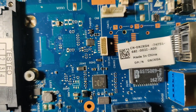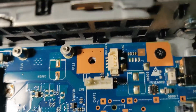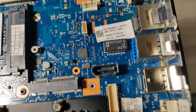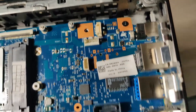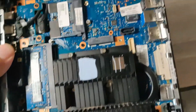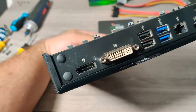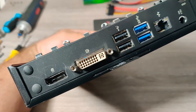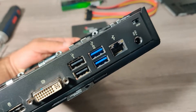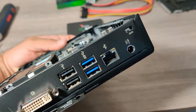There are some other headers here which I don't know much about. I believe the one on top right there is a power cable that goes with this other serial ATA port, but I haven't been able to find the adapter that fits there. This is another header that I'm not sure what it's all about. A lot of unknowns in this little machine, but it is a pretty fast one. It's a quad core and it has a DisplayPort and DVI-I, so that means I can do VGA. It has two USB 3.0 ports and two USB 2.0 ports, and a gigabit Ethernet port.